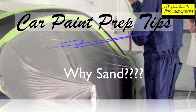When you're selecting a grit, you want to select one that does the fastest job with the least amount of effort. Now, depending on what you're spraying, it's going to determine the grit also. So for primer, like I mentioned, anywhere from 150 to 220, that primer is going to fill those with no problem and block out, primer surfacer. Paint, you would see the scratches if you sprayed paint. If you sprayed paint over 150 grit, you're going to see those scratches. So we've got to go with something finer.